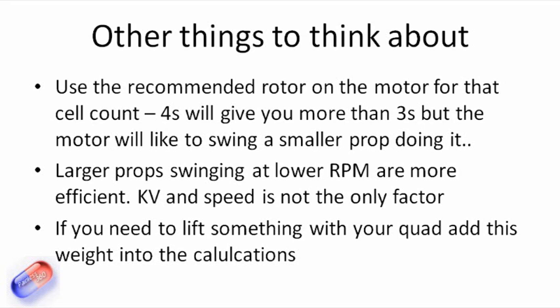Thanks to Lucian Miller for helping me figure this out: larger props swinging at a lower RPM are much more efficient than smaller props swinging quickly. I used to think the faster the motor was turning — the higher the kV — the more power the prop was giving out. That's not the case. With my big quad, the D3536 motors run at only 910 kV but have 11-inch props with 4.5-inch pitch. Compare that with smaller motors at 1800 kV running a 7-inch prop — the bigger prop with the bigger motor will produce over twice the lift of the smaller one.